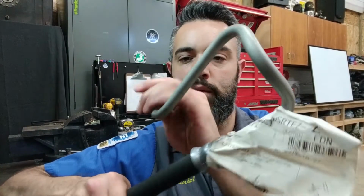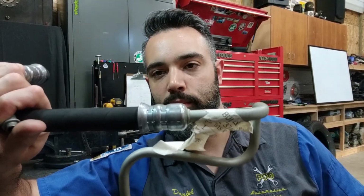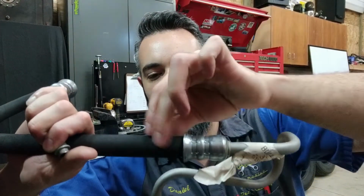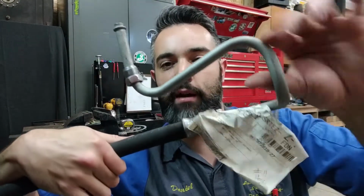The other end is also going to have a pressure crimp fitting, crimping the hydraulic pressure rated hose to a hard line, and then that hard line is going to be routed however it needs to be routed to attach to the next component, whether that's the steering gear, the brake booster, wherever this is. It's going to have another flare nut with the threads acting in the port and pushing on the backside of the flare and sealing that line. The pressure side of the hydraulic power steering system is more likely to show a leak at some point, because that is under pressure and it's operating under pressure constantly.